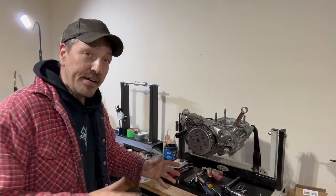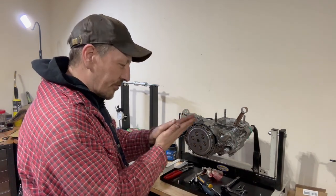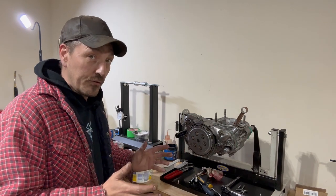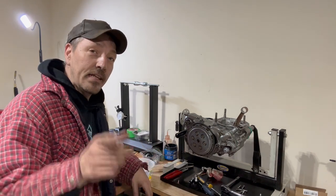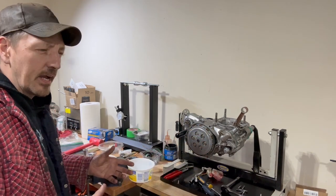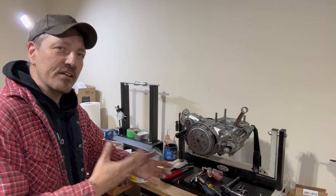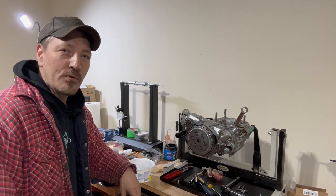Our big hopes and dreams of doing the top and bottom end in this video — well, they didn't happen. The bottom end gave us some trouble with the transmission. I did not see the two washers stuck together — I thought it was just one washer, and I was seeing the C-clip and thinking that was the washer. I have seen transmissions fail like that before, and usually it's a missing washer. Anyway, like and subscribe, leave a comment below — what color do you think we should do the clutch cover? I'm a big fan of that burnt bronze copper color. If there's anything I didn't do that you guys do when putting your bottom ends together, let me know so we can all learn from it. Thanks for watching!